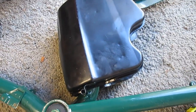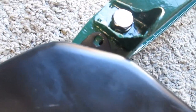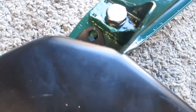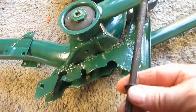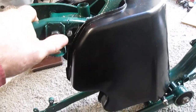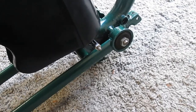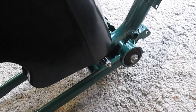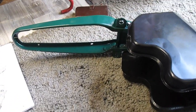The next thing to do is to attach the petrol tank. It's attached on the frame there on both sides with a 6 by 12mm bolt, and there's a long bolt that actually goes through. That's the petrol tank in position — 6 by 12mm bolt both sides and a long bolt through there. I'm going to put on the rear suspension there now next at both sides.